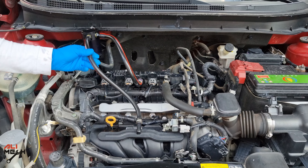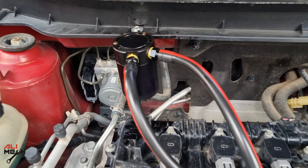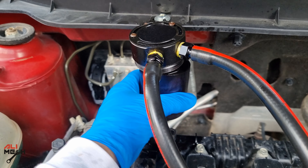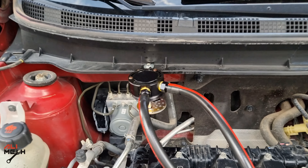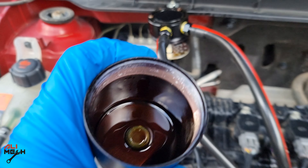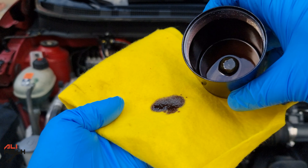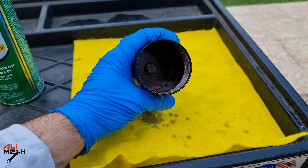It's after 5000 kilometers and it's time for an engine oil change. Let's check the oil catch can and see how much oil is being collected. Here is that much oil being collected from entering the intake manifold. If we don't catch that oil with the oil catch can, all this oil will be burned on the intake valves and piston head. The amount of collected oil changes depending on the quality of oil and the engine type — some have more oil vapor than others.